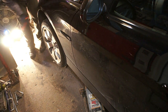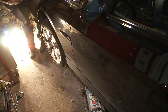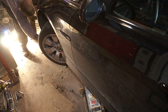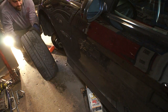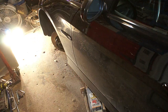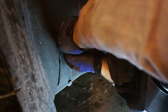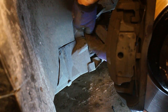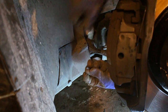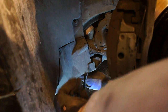The first thing you're gonna have to do to gain access is get your wheel off. Always remember to use some anti-seize on the back of your wheel, otherwise they will get stuck onto your car like this one did. The bolts are pretty easy to gain access to — you don't have to take off the whole inner wheel well liner. There's just a little access cover here. There are two different fasteners: screws that go in, and a bolt on the bottom. Take that off and then you get the first view of the bushing.